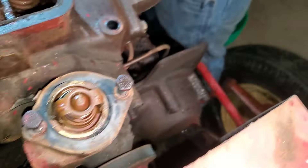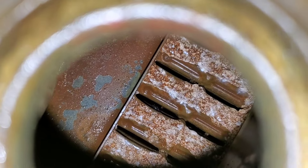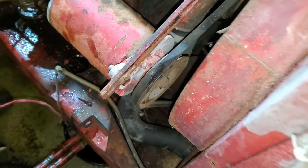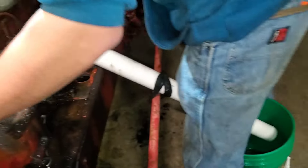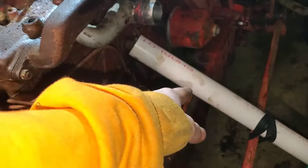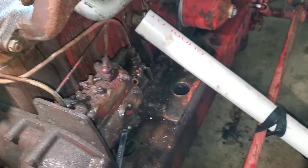Assuming we have to pull the sleeves, which I bet we do. The radiator's a little dirty but the fins aren't all corroded out, so we should be okay. Water pump's the next thing to come off, along with the generator. Coolant's draining through our pipe so it doesn't leak all over the floor. That's one thing I hate about these tractors — the subframe makes it leak everywhere, goes down one hole and comes out six different ones on the bottom.